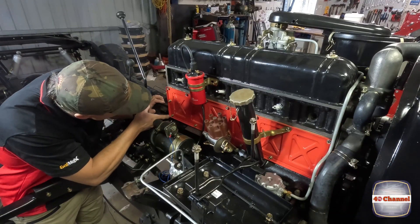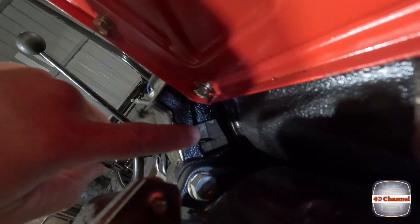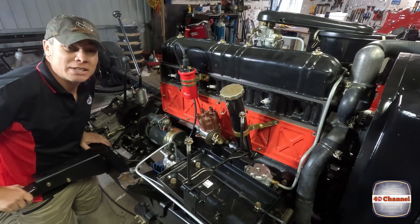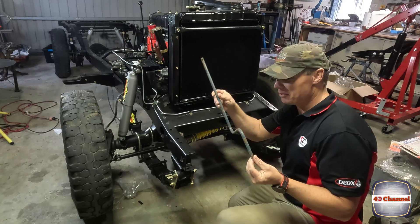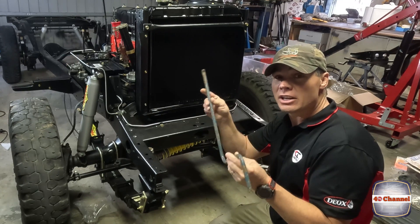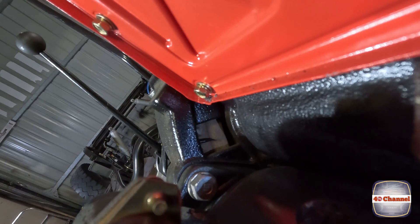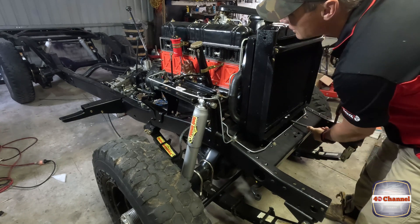Just behind the starter motor we've got this little gap here. On your later models they've actually got a little plate there you can unscrew and remove. On this earlier model it's fully exposed, so we can see this little tiny needle here. We're going to turn the motor until we find the little tiny dot, spin that around and get it into top dead center, and check to make sure it is on top dead center number one.